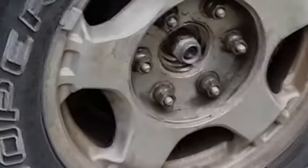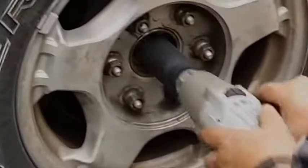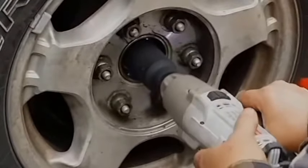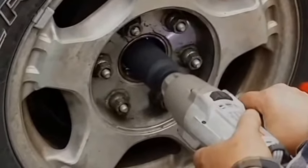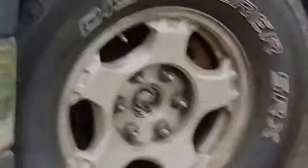I'm going to run in the 36mm axle nut a little bit with the impact gun — I am not trying to torque it with this, that is not the proper way to do it. Just snugging it. I'm going to drop the car, torque up my lug nuts, and then torque the axle nut to 155 foot-pounds. Then the cap goes on — you'll pry that off with a screwdriver or a small chisel to take it apart.